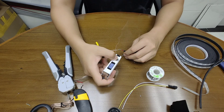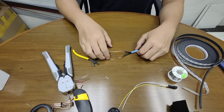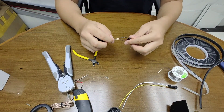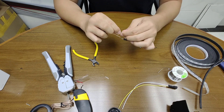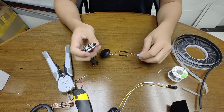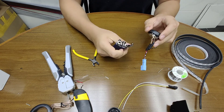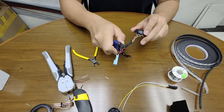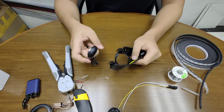That's done for one side. You can see now it's pretty much solid. Cover it with the plastic heat-shrink tubing to make sure there's no short circuit in any situation. Use a torch — any lighter will work, or you can use your soldering iron — but direct fire is faster. That's how you prepare your tweeter with the OEM connector.